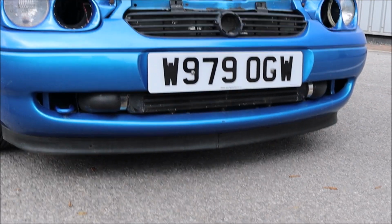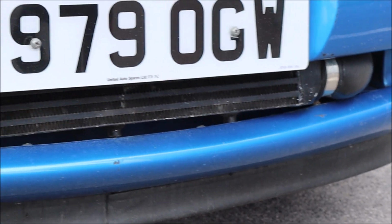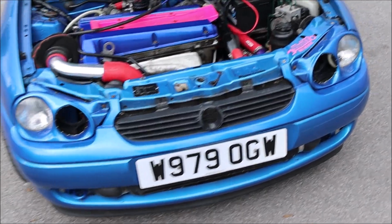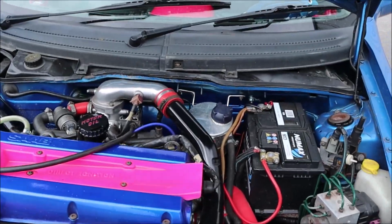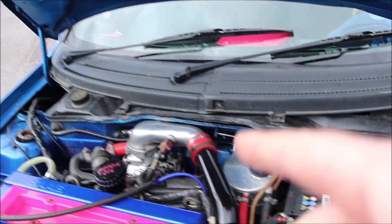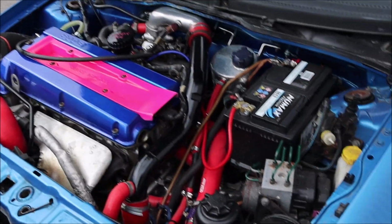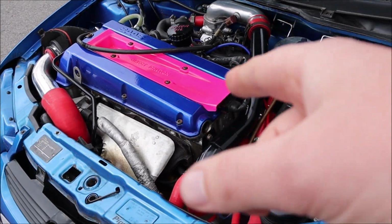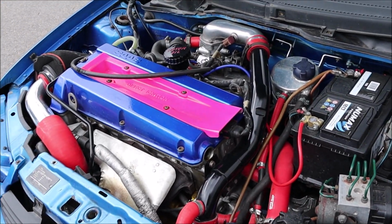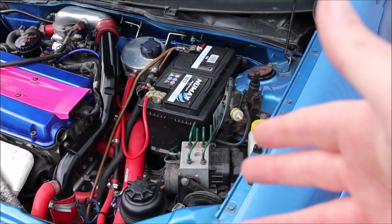And then we've got the cheekiest little intercooler there that's all black and stealthed out. You can just see it there. But we will be sticking a slightly bigger one on, because we've got a set of 875 Deka injectors. The ECU is going to get sent back off. We're going to go with a 3-bar map sensor, and we have got a TD04 19T with a 7cm housing, and we should be good for 350 horsepower upwards, depending how long the gearbox lasts, because we were only running an F20.